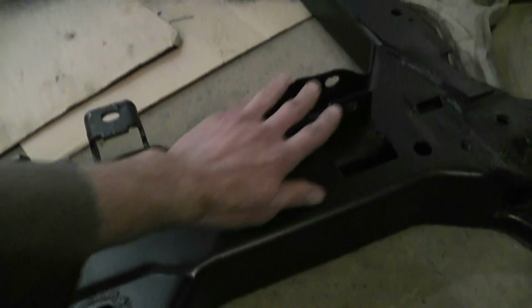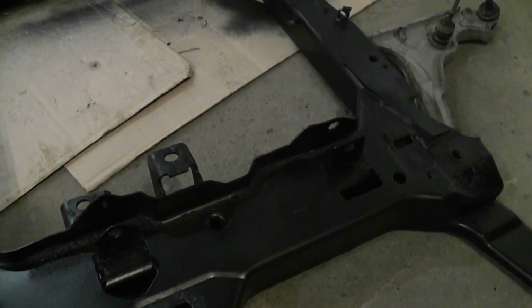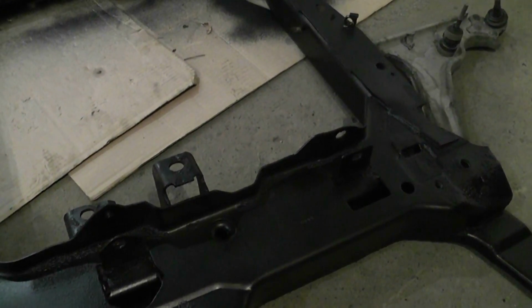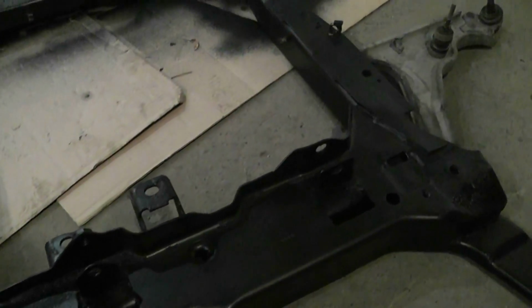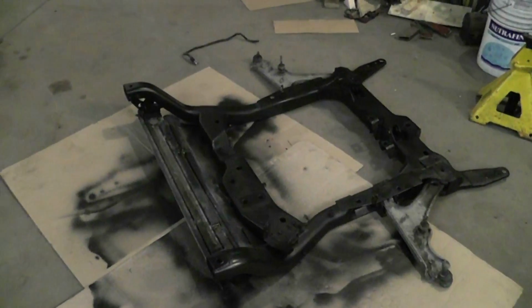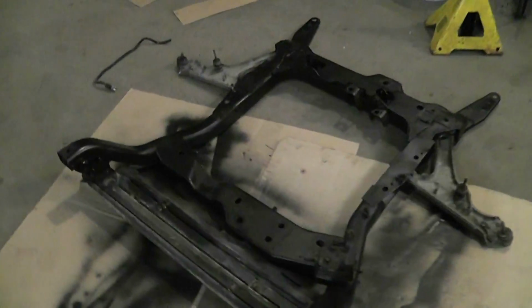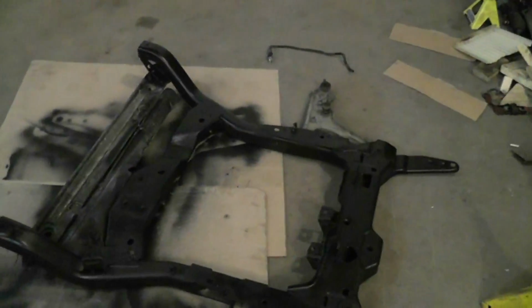This whole piece here has rotted away from the vehicle, so her whole steering rack has come away from the subframe and she has little steering. The whole shaft shows, the whole thing moves. But I got this one from the wreckers. Well, actually, Dan brought it. They already had it out of the vehicle, so that tells you something about 2005 Grand Ams. So, got it all rocker guarded. It's a really good condition frame, so I'll pull the car in and show you how bad hers is.